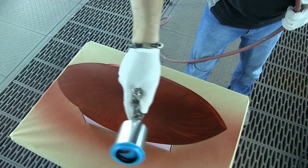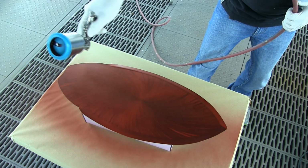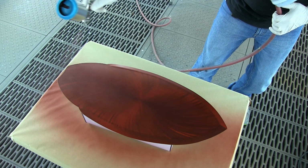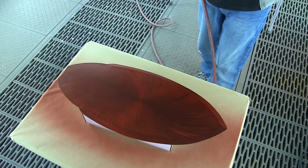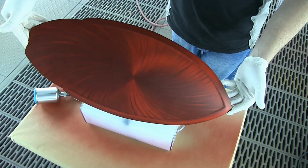Starting into my third coat now. I'm going to be spraying everything here today with 4 coats. We recommend between 4 and 6 coats. That's really your discretion. Just whatever you want to go for, whatever look you're after. But the gun is completely set up for me here. I'm actually full throttle here on the trigger, but remember I've got that fluid adjustment valve choked in, so I'm always in control of how I'm spraying.